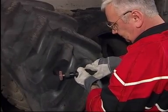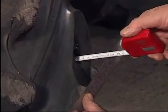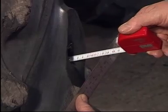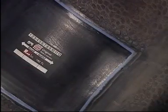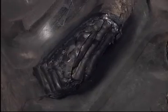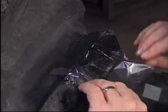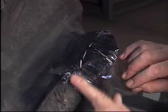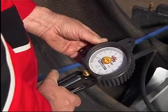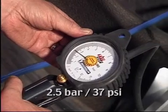The injury is skived in the normal way. The cure time is calculated by measuring the depth of the lug and referring to the cure chart. Then place the patch repair unit into the tyre. The lug is built up, making sure that it conforms to the original size and profile. The area is covered with heat-resistant foil and then cured using the Vulkstar. Lower than normal pressure is used for curing agricultural tyres: use 2.5 bar, 37 psi.